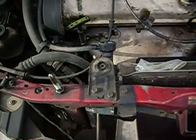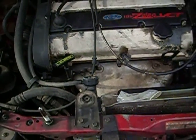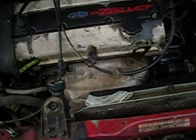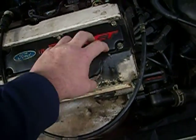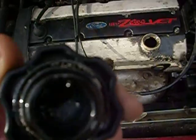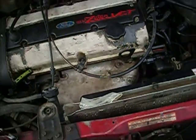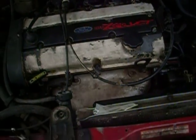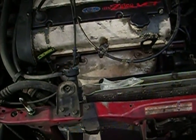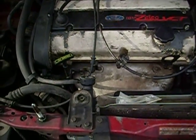So I've determined pretty positively that we've got either a blown head gasket, a warped head, or a cracked head — something in that area is damaged or defective. Also, come over here — I don't know if the camera's picking this up, but there's that slight spotting that looks kind of like caramel. That's a pretty classic sign that you're getting water in the oil. That wasn't there when I bought the car, because I wiped all that down. So I think we've done a pretty definitive redneck test — at least one cylinder, probably the one with 100–110 PSI, is getting exhaust gases into the coolant system.